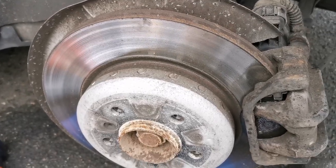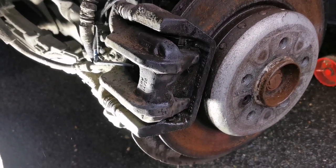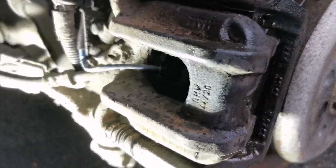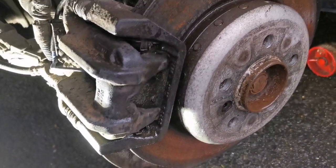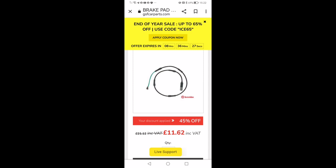Three down, one to go. The fourth corner is now done — the second rear — and they do the sensors diagonally opposite: on the front it was the passenger side (nearside left in England) and on the rear it was the driver's offside rear. Managed to get the sensor out without breaking it, put it back in, ran the piston back the same way, and the wheel's back on. The brake light is off. I'd recommend changing the sensor when you change the pads. Hope this helps someone doing the brakes on an F10 5 Series BMW — please like and subscribe!